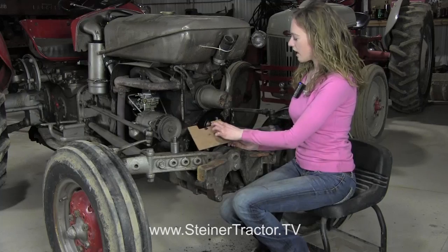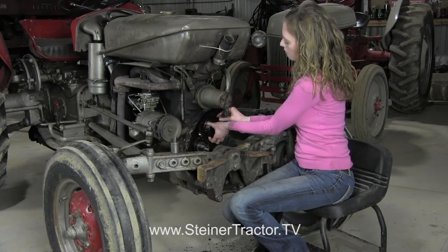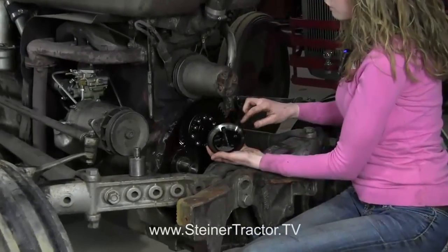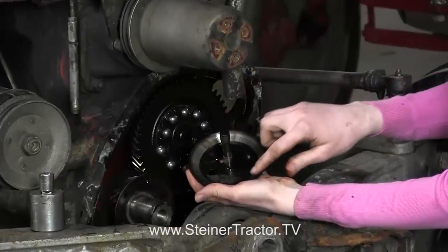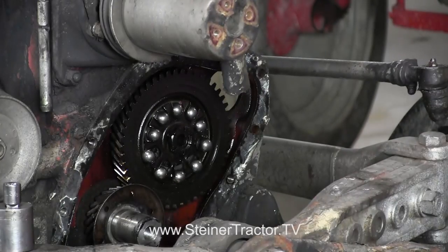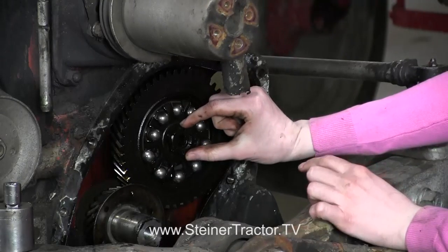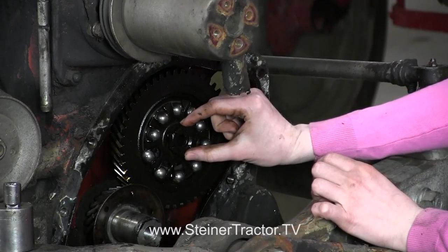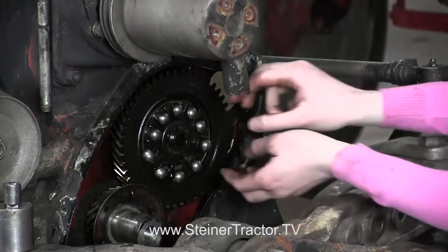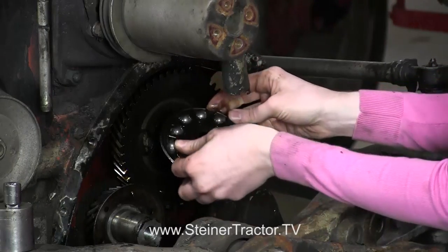I have a piece of cardboard cut out that I'm just going to set down here. When I take the cover off the governor, the rollers may fall out. You definitely want to inspect the inside here. I can see that there is some wear around this outer lip or edge, and yours probably will be worn as well. Then we have all of our rollers in here. Don't be alarmed if these fall out. There's a nut on the end here that I already have loosened up, so this will come out — just used a socket to loosen that up earlier. Then this cover will come off and all the rollers are staying intact.